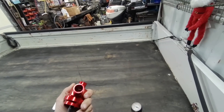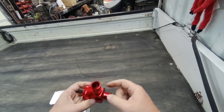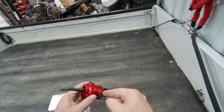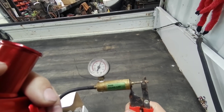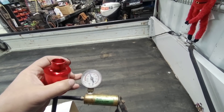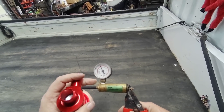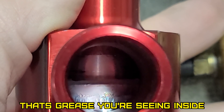It's open. Now people are saying this isn't gonna work because this is made for boost blow-off, but on the contrary, if you're doing too high a vacuum, it's gonna do the same thing through here. Technically it would even without this because it's still pulling on this. But when does this start opening? Let me blow on it. So this just opened at 15 inches of vacuum. At 20 inches of vacuum it opened up enough where it's pretty free-flowing blowing through with my mouth - pretty wide open, opened all the way. Now it's closed.